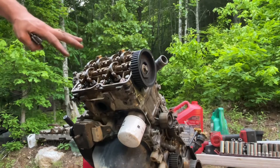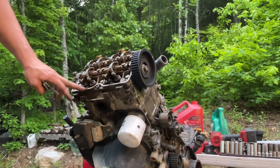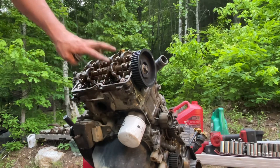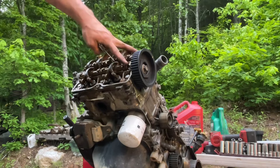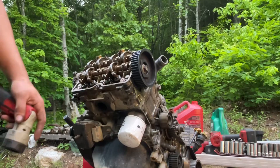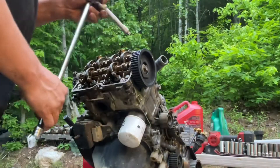Since I'm just doing a valve guide and not a whole head job, I'm not going to take this plate off — I'd have to RTV it back down. I think I can do it without taking that off. I'm going to pull off these rocker shafts and get them out of the way, then take the head bolts out and pull the head. Then I think I can work on the valves without taking all the rest of that stuff out. Half-inch breaker bar and a 3/8 adapter on this socket, start in the middle.